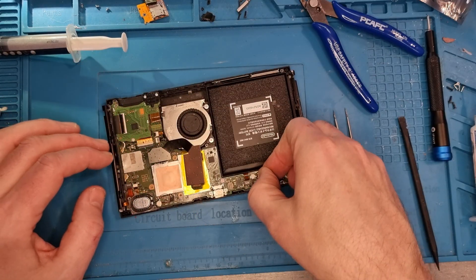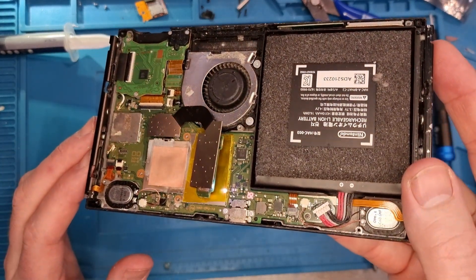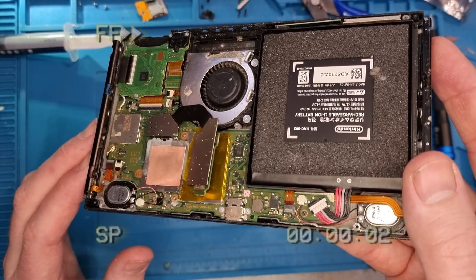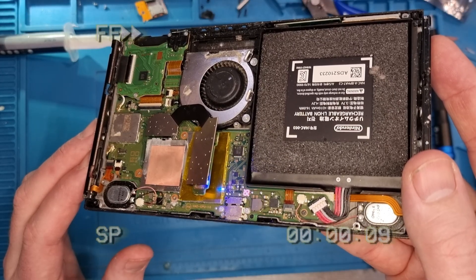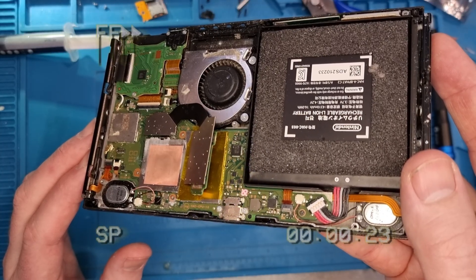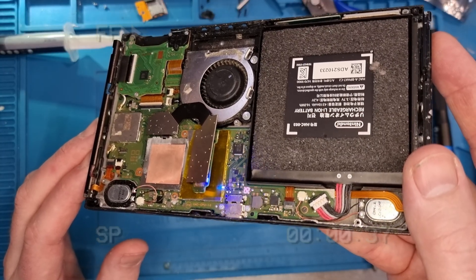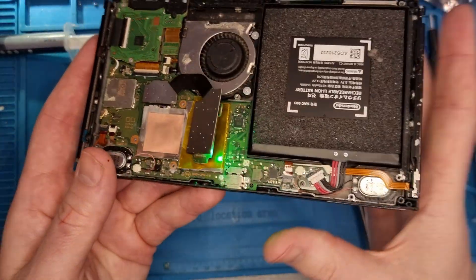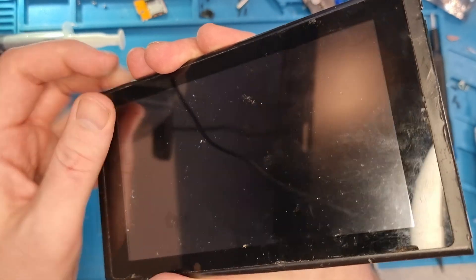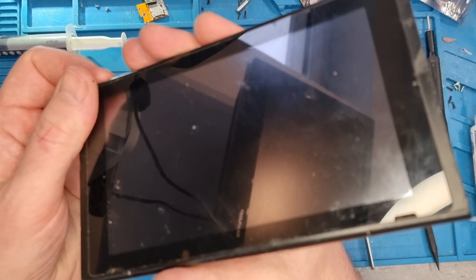A little bit of kapton tape underneath again to stop any shorts. Now we can test it — put the battery in, turn it on, and then the light should flash. This is just trying to glitch the system, so the first time you do it, it can take a few seconds. This one seems to take a lot longer than previous ones I've done. I don't know if it's to do with the software that's installed or the chip itself. I did fast forward a little bit — I was panicking for a few seconds thinking I might have done something wrong. But then there was the green light, and we can see 'No SD card', so that means it's working. Turn it off, turn it back on, and after that it should boot up a lot quicker — now it knows how to glitch it.